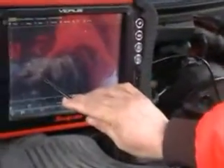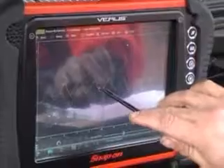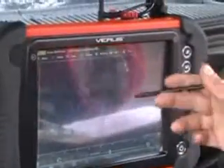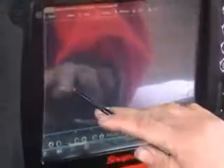Now if you look at here, that's our fuel pump operating normally. All the humps are uniform and you should have eight humps on the waveform. Each hump is a commutator bar. So we see here that that's a good waveform. We freeze it and we count it.